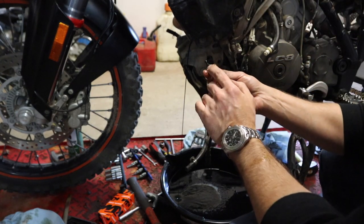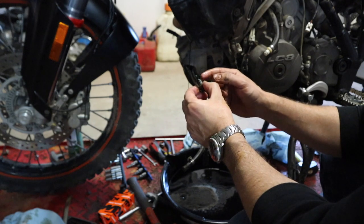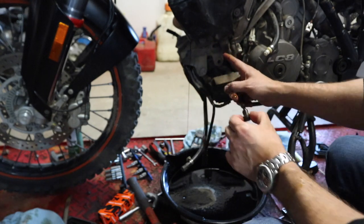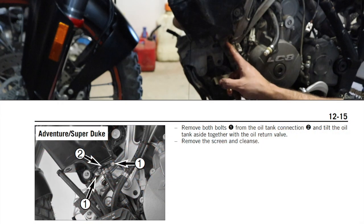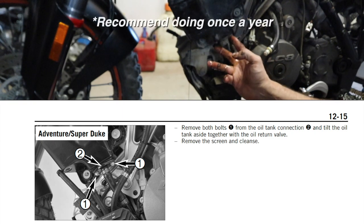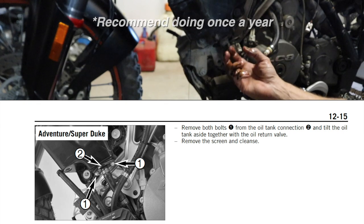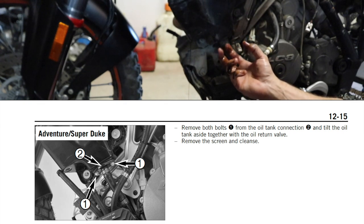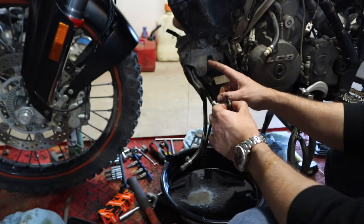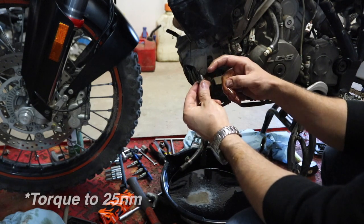While that continues to drain — this is a magnetic plug, so we want to make sure to clean this up. We're actually going to make a modification to this bike so we don't have to take the left-hand side of the tank off anymore. Technically the factory calls for lowering this piece out too since it sits a little lower, but we're not going to do that today. That's two 8-millimeters — you'd pull this screen down and let it drain. It's a very small amount of oil and we're going to try to get away without removing the left-hand side tank. Once this finishes draining, if you're replacing this, just clean it up, put a new crush washer on, and pop it back into place.